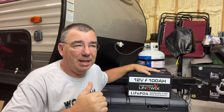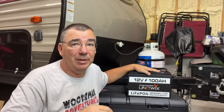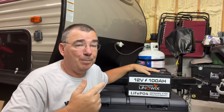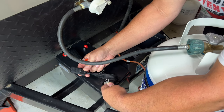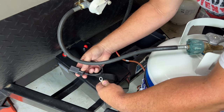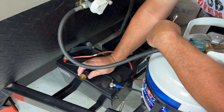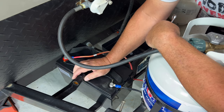Let's go ahead and stick this on the camper — I just want to make sure it runs the lights. There's not much to check right now: 12-volt lights, ignition for the stove light, and ignition for the gas furnace. Anything I plug in to charge phones or run my portable refrigerator will work off this battery when we're off-grid. I have an adapter so I can run a portable fridge from up here in front — it's a DC jack, positive and negative. I'll need to add an inline fuse on the positive line to protect it.